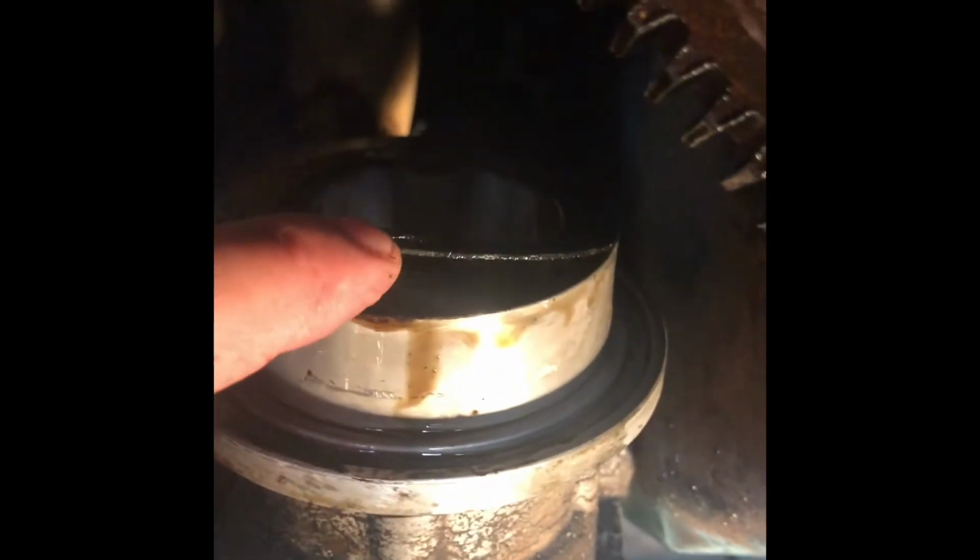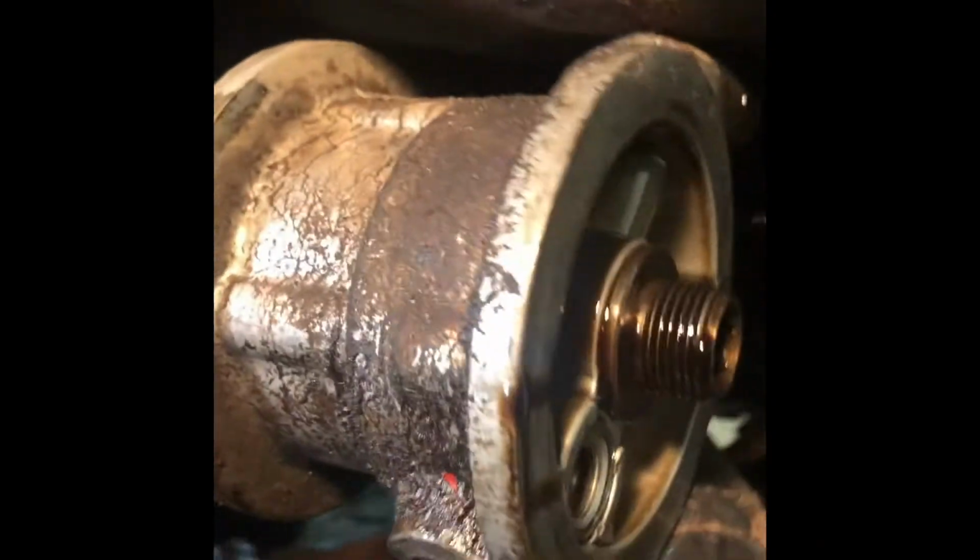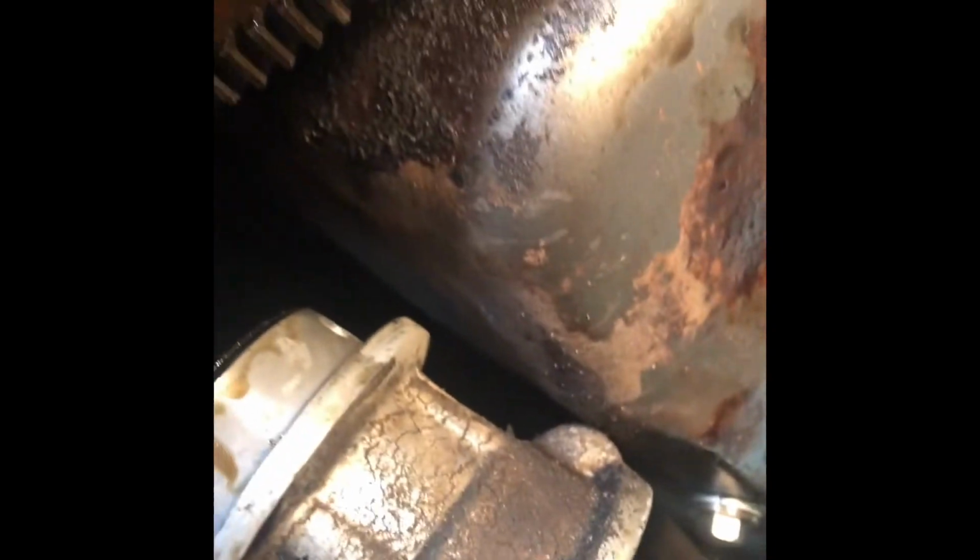What I found out was I got the little gasket right there pulled out, and that seats in right around here. And there's this other one up here. This one's pretty paper thin. It's like, I don't know what the heck material it is. Felpro or something. And the Allen wrench nuts that were in the bottom of that thing were pretty darn loose. Since the majority of my oil leak, as you can see, is always on this exhaust over here, my culprit, I think, is this. That's giving me my majority of the oil leak.